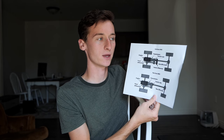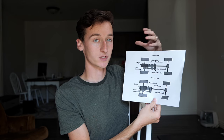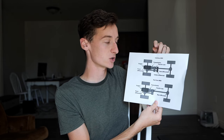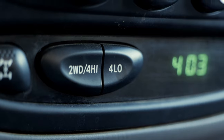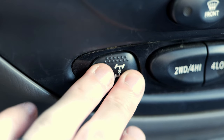What Toyota has done here is really nice for the user: you can use your four-wheel drive on the road very easily — on a gravel road or snowy roads — as if it were an all-wheel drive system. But if you need a more aggressive mode of traction, you can lock the differential and use essentially part-time four-wheel drive. Toyota has given users the flexibility to choose whichever mode they want. In addition, the Sequoia also has low range gearing just like a normal part-time four-wheel drive system, so you can use four-wheel drive low with the center diff locked or unlocked, providing a ton of flexibility.